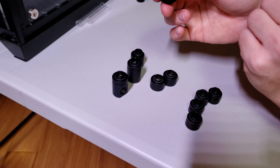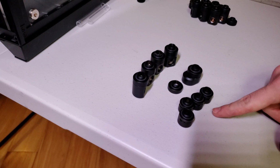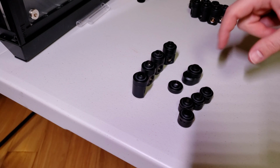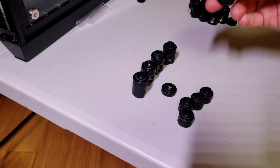All right, these are our fittings that we're going to use to connect the CPU monoblock to the distribution plate. Again, as always, we've got our 4 hard tubing compression fittings. We have, in this case, 4 90 degree rotary fittings. This is a very common theme in this build. And then the 2 kind of oddballs that you'll see how they go in a moment here. We have here a 7 millimeter EK extender, and then here a 7 millimeter EK offset. Both 7 millimeters, but clearly totally different things.